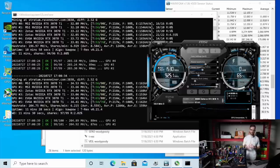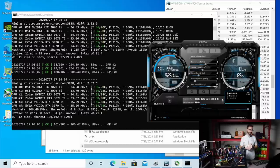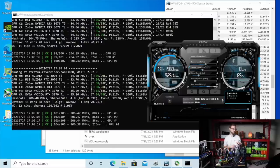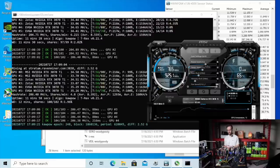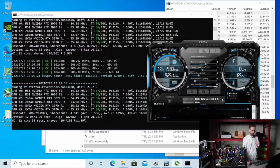And then do my overclocks and push it after to see how much of that mega hash I can make up or how much more I can push it over what its stock reading was. So we're back up to 216 watts on all the GPUs. Those EVGAs seem to be the best cards out of this — it's no surprise. Even with the size of the coolers on these MSIs, the silicon in these EVGAs is doing more mega hash for less wattage. Just like the 3070s I have — absolutely killer cards. Nice job on those EVGA.